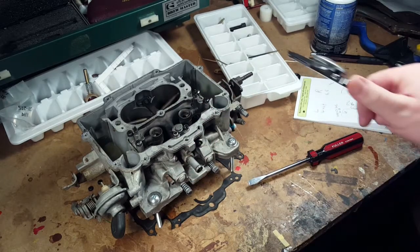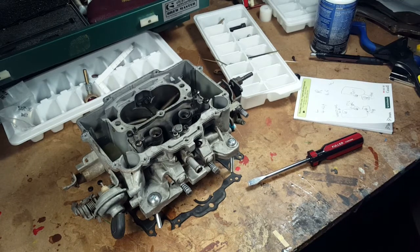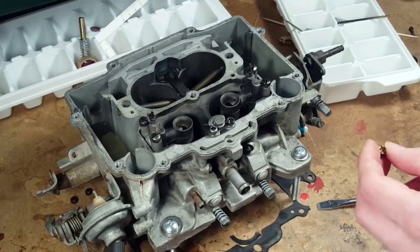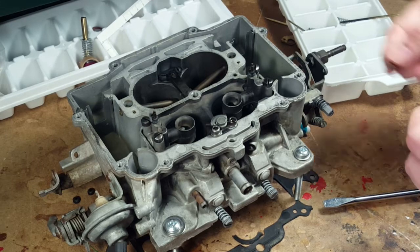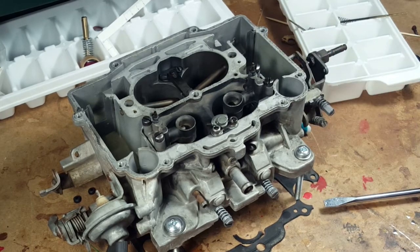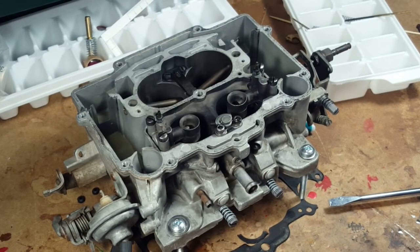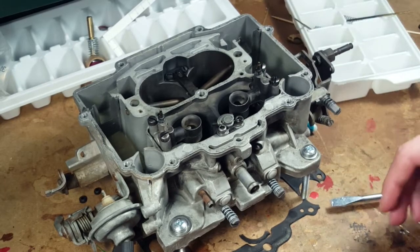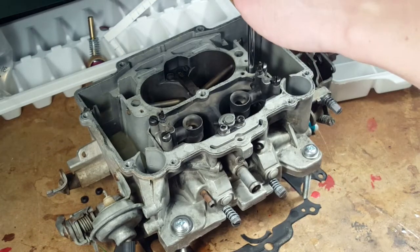There it is, right on. Spot on. Okay, so next we put back the jets. We'll pull out the 392s, they're the shortest ones. Now putting it in, probably with tweezers. And this one, you go backwards until it clicks.